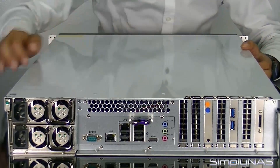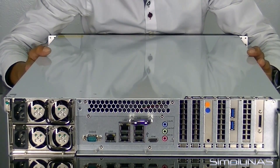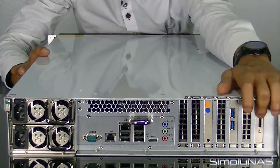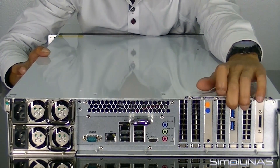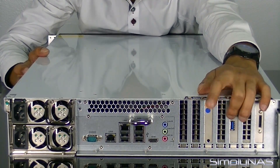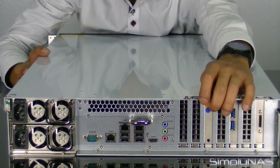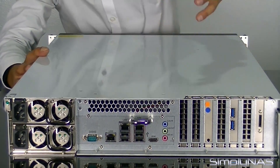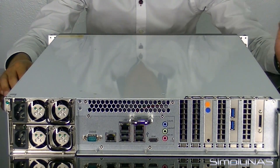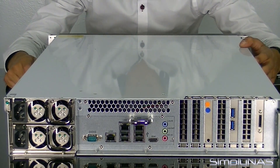You've got your expansion slots for 10GB cards and RJ45s. The expansion units for Thecus don't need a SAS card like QNAP NASes — they plug in via either eSATA or USB 3.0, so generally reserve those ports if you plan on using an expansion unit. Thecus do sell their own 10GB cards — the C10GTR is the Thecus 10GB card. They also sell their own USB 3.0 expansion card, so you don't have to worry about compatibility.